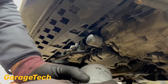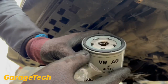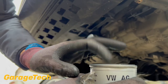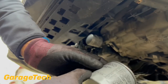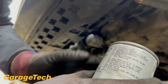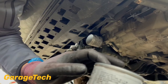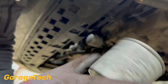This is my oil filter. What you need to do is just put a little film of oil around the seal before you put it on. It's also good practice to top the filter up with a bit of oil as well — sometimes it's quite tricky to fill it up and then by the time you get it up and try to fit it on, some of the oil will spill out again. Put a film of oil on there, and just check where the oil filter actually sits to make sure that the old seal hasn't stayed on there. Because if the old seal is still on there and you put this one on, it will most certainly leak. So just be careful of that.